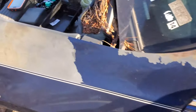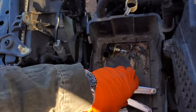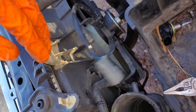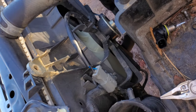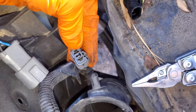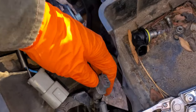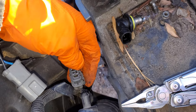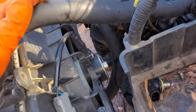One more tip: let's say you've tested all the fuses and swapped the relays around and everything checks out. Probably the best way I've found to see what's going on is to just disconnect the fan in question. You can see if it spins freely — a lot of times the fan won't even move when the motor is locked up. With it disconnected, the black wire should measure ground, and in this case the blue-black wire — the other side has a blue-yellow wire — that's where the power comes in when the relay is activated. If you throw a voltmeter in there, you should be measuring power if everything's working properly. So if you see power between those two pins but the fan's not turning, then you know you have a bad fan.